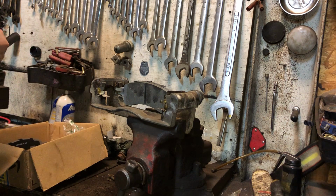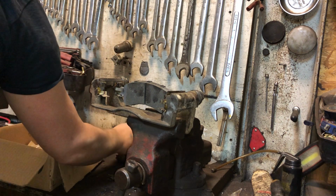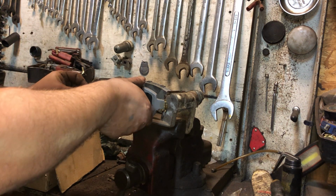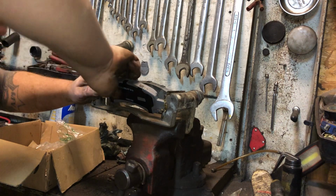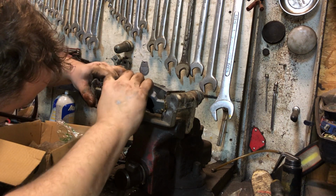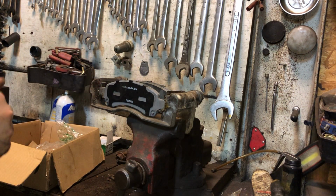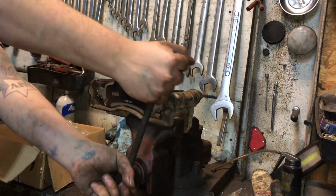So now we'll get our outside pad in. This one doesn't have a squealer tab. Just a light coat on the ears, to keep the ears from rusting over time. I found a lot of brake grease wears out real quick from heat and rain, water. But this brake grease really lasts a long time. That's why I use it. There we go. Got this one locked in. Having a lot of practice with this style really helps make it look easy.